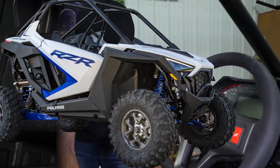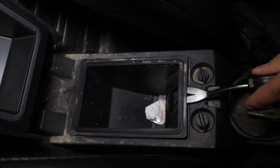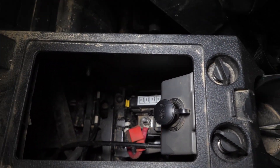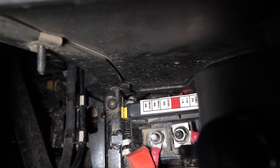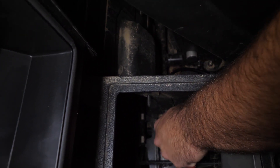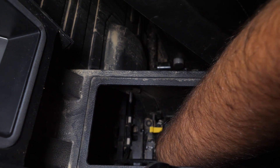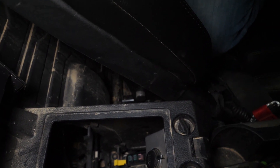Then we're gonna climb up in the machine. The next thing we're gonna do is go to the center storage compartment, open it up, and remove the center section. It's kind of hard to get your hands on it, so I usually just take a pry tool, slide it in here, and pop it straight up to remove it. Now if you look straight down in there you're gonna see another little fuse panel. The fifth one down from the top is gonna say EPS — that's the one we're gonna remove. Pop the two yellow tabs back, remove the cover — it'll have a tether on it so you can't completely remove it. Count 1, 2, 3, 4, and 5. It should be a 30 amp fuse. Go ahead and remove it and sit it up here out of the way.